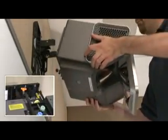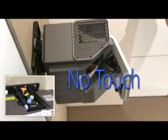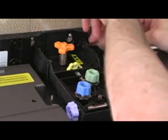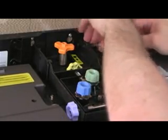When mounting the projector on the wall bracket, or when working around the projector, be very careful not to touch the projector's lens or the mirror. Be sure to install and tighten the 3 screws which secure the projector adjustment bracket to the wall mount plate.